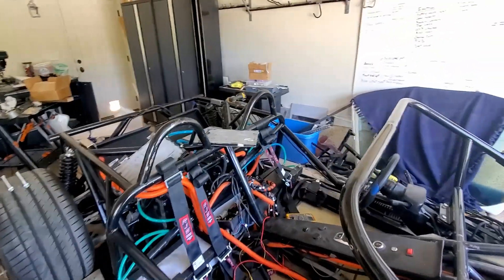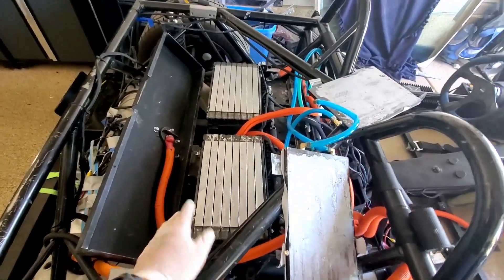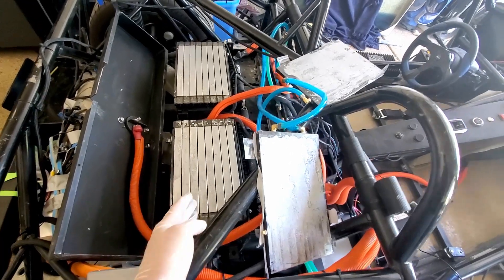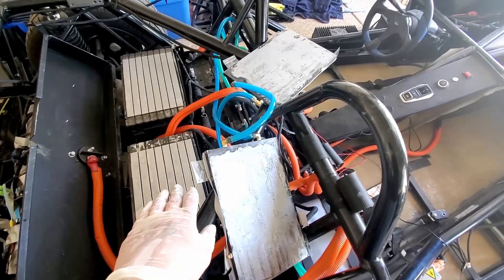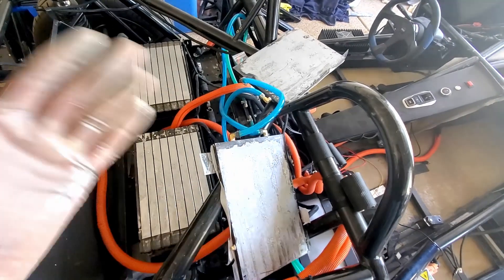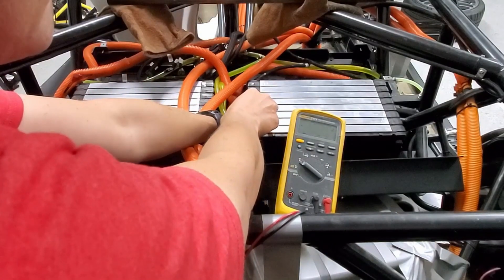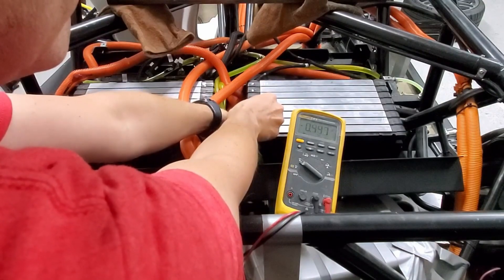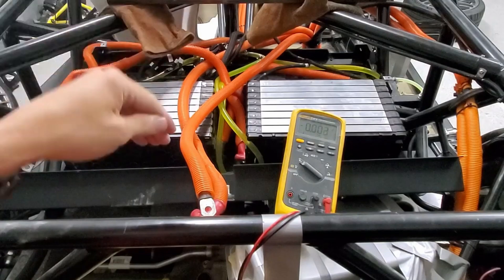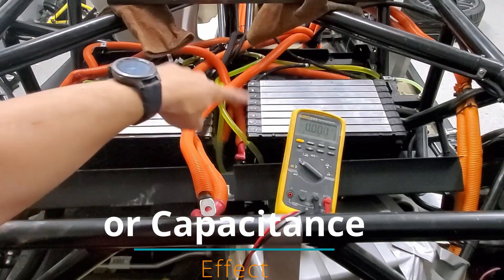I definitely think the cooling plates are playing a big factor. This side of the battery has aluminum fins that go in between the pouches on the battery modules, and that allows for cooling. I put thermal paste on for good thermal conductivity to the plates. Looking at an older clip, it started out around 10-11 volts - and there shouldn't be any voltage difference there. It's not like a wired circuit - it's just a leak to the cooling elements.